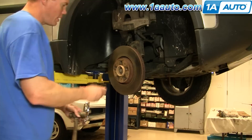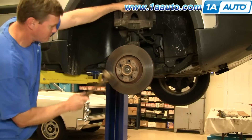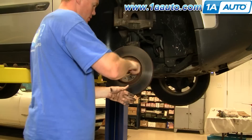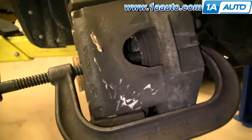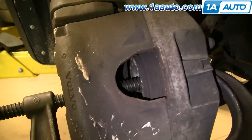To get the rotor off, I'm actually going to put a lug nut in — if the rotor comes loose quickly, that will just hold it in place. Use the ball end of the hammer and give it a couple good wraps right on the hub, and it should come loose. Then I've just bolted my caliper on just a little bit, threading the bolts on to hold it in place. Using a large C-clamp — what happens when the brakes wear out is this piston works its way out of the caliper, so as I tighten the C-clamp you can see the caliper go back inside. Tighten it up and force that caliper piston back in.